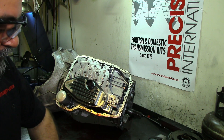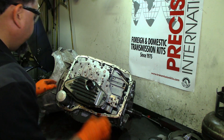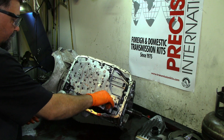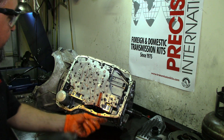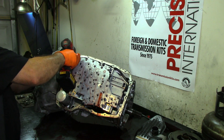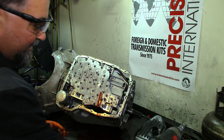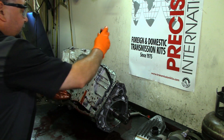If you drive it for a week or two it may not live long at all. But if you service it right away, it'll give you a couple months of life. The best thing to do immediately is change the fluid, remove the return cooler line, and start pouring fluid in until clean fluid starts coming out.